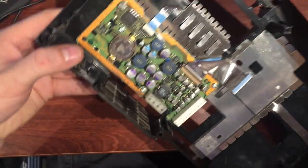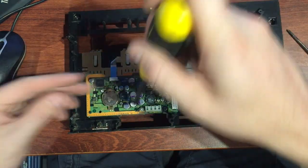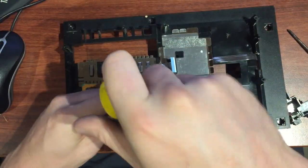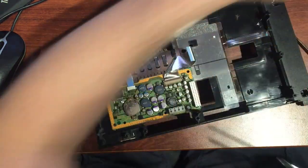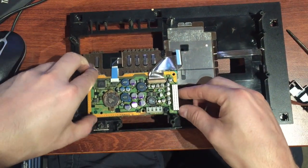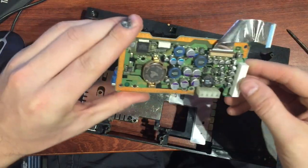Back to the main base, we're not left with much — it's just this board here. Looks like a couple of screws — one, two, three — so let's rip them out. These are the silver ones, so not hard to remember. That ribbon should just lift up and pivot. I wonder if I can pull that ribbon out with that blue tab there — yeah, that comes right out. So that board's released. The ribbon looks like it goes all the way through, so we'll just leave that and give it a clean.